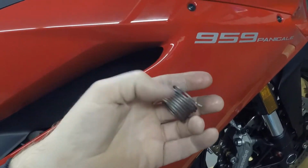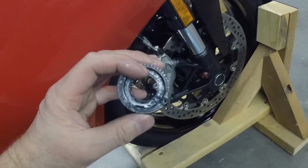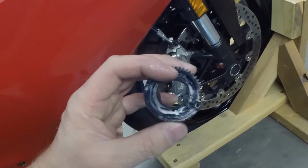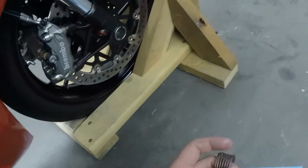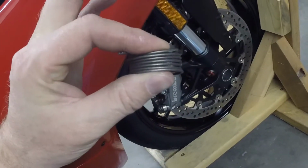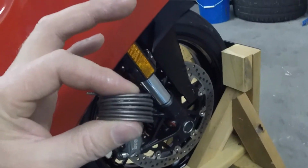So I'm going to start by measuring the diameter of this that the spring needs to sit in. Grab a socket or some other piping or tube or something, and just wind the wire around that. And I'm going to wind it until I hit that thickness for the total width of that spring. So that's what we're going to do next. We'll see how it goes.